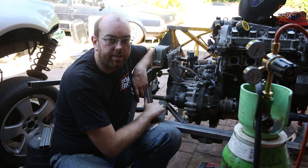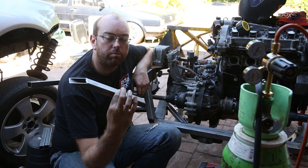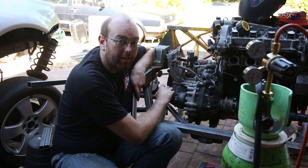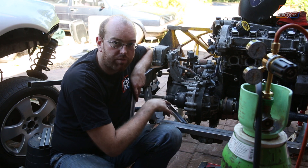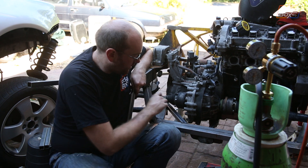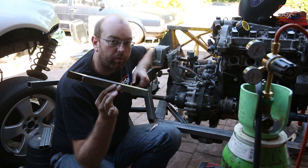We've tacked our first stay in and also tacked in one of the back braces to stop it moving left and right. We're going to leave the vertical braces for now because they'll be much easier to fit once the engine is back out when we come around to seam welding everything properly. So this is as far as we'll go for now, and we're going to fill up the other side and fit it.